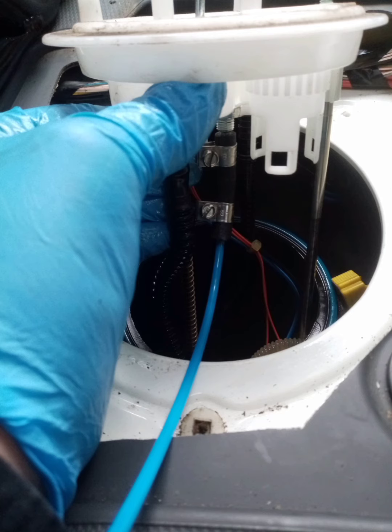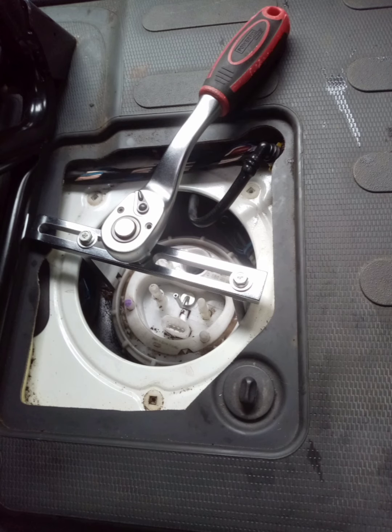Make sure now the rubber o-ring on the underside of the sender unit is sitting in its position correctly and place the sender unit back into the tank. It will only go into one position and you will feel it when you push down on the spring mechanism. Now place the tank sender unit tool back in place with a little bit of downward pressure and tighten in a clockwise position — not over tight, but just so you know it's secure.